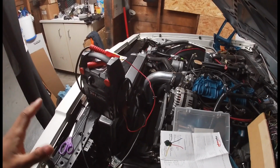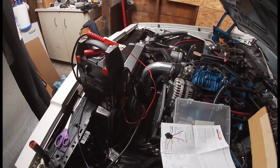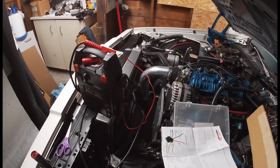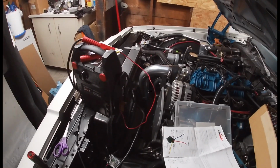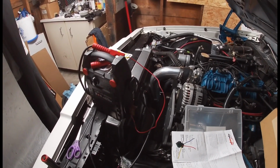You'll probably have some trouble trying to plug in all of these on your normal setup on an old school. I think it's just too much amperage, too much draw on the stock headlight switch, and this normal OG setup, it just won't work right. And if it does, it probably will fry the ballast or fry something, or fry a wire or something.